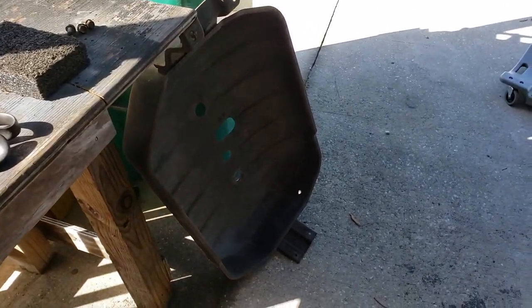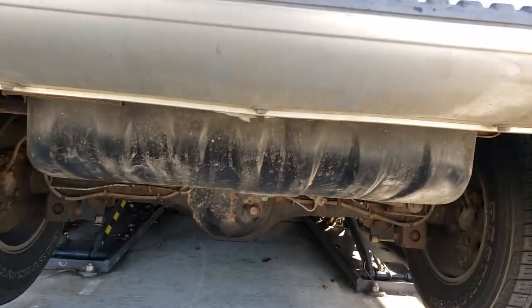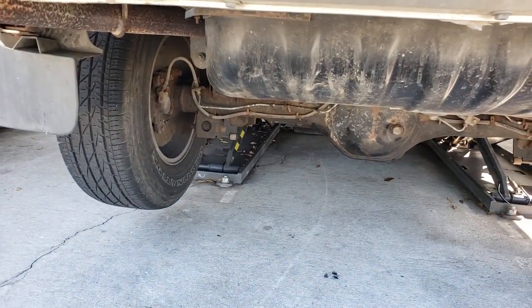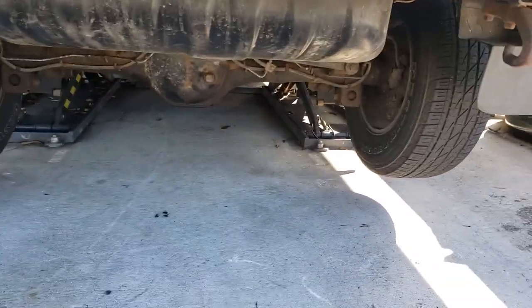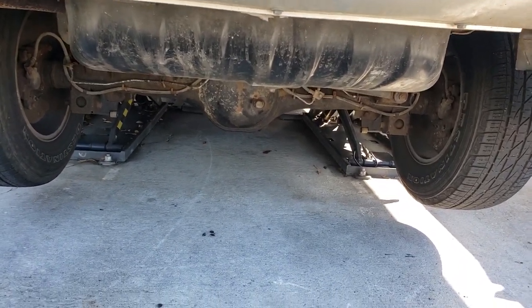You can see the steel cover for the gas tank. I got my creeper — broken wheel, cause I'm fat. There's the gas tank without the cover. Over here on the driver's side, the left side, there's three nuts you can get to. I dropped the tank on one side yesterday and was getting an EVAP code — a P0446, which is the canister vent valve. Well, it wasn't really the canister vent valve — you gotta be careful with those.